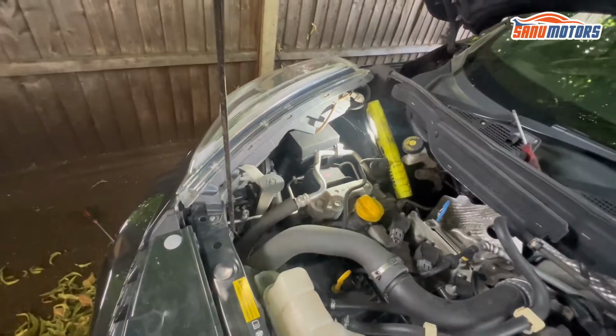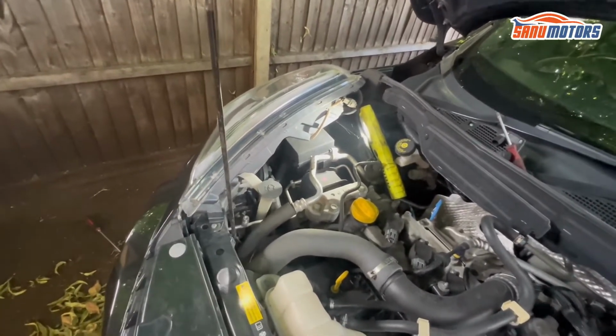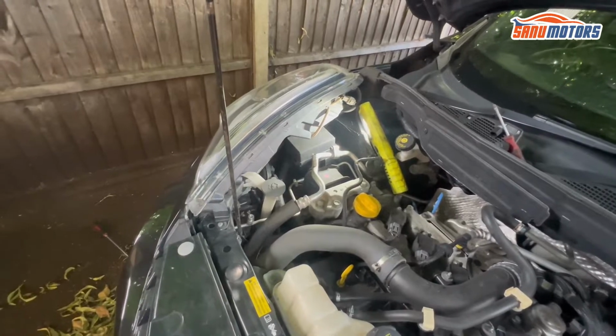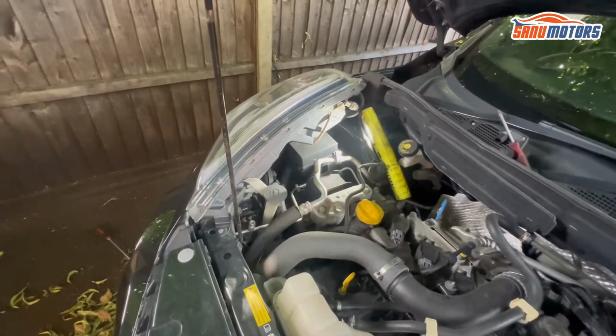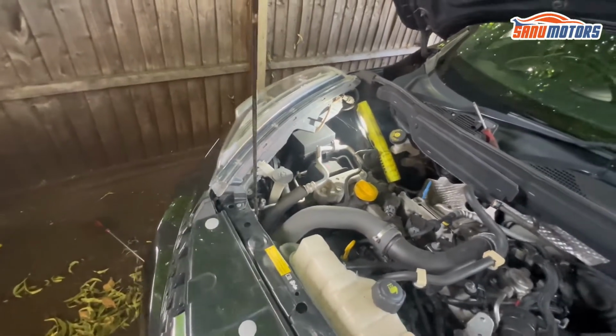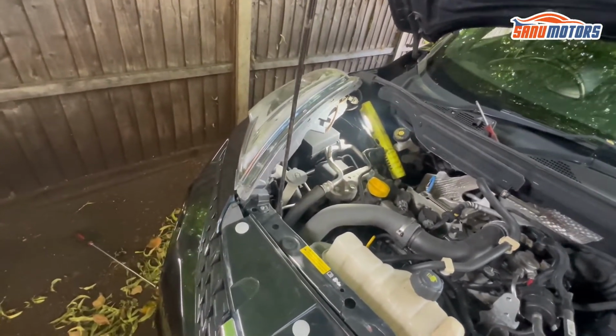However, I'm going to first service the system, and after that check the vacuum test. Then if it's okay, I'm going to refill gas with UV dye. Let's go with the machine now.